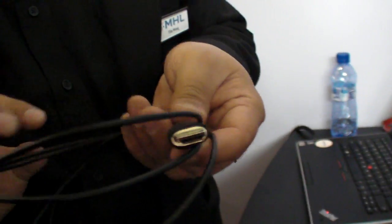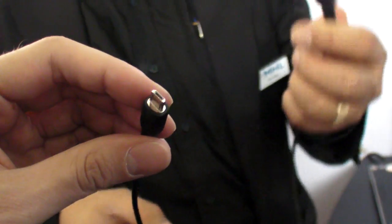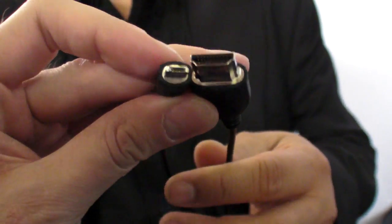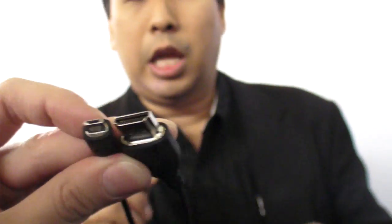So is this cable special? This is the actual cable we're using, so you can actually see it. It's special in the sense that it has a standard micro-USB connector on one side and then it actually has a standard HDMI connector on the other side, but we're only using the connectors. The cable is just five wires and it has MHL signaling over that cable. So that way when I plug this cable into the TV, it'll auto-recognize this as an MHL connection and basically provide power and then audio-video.